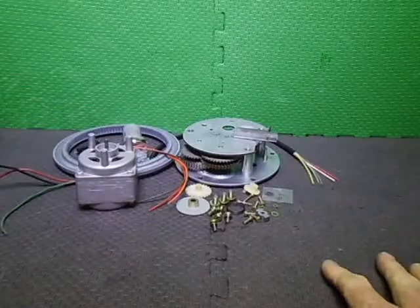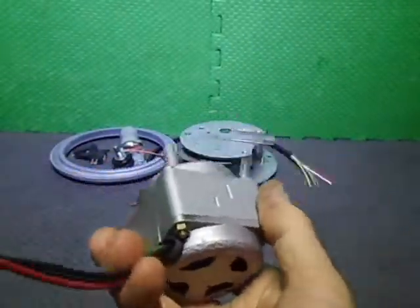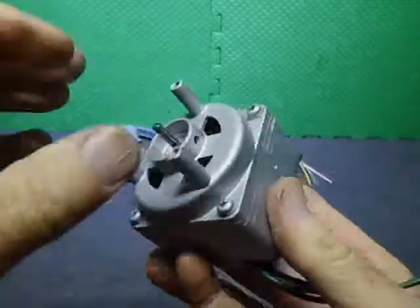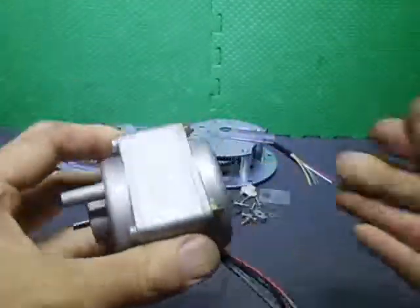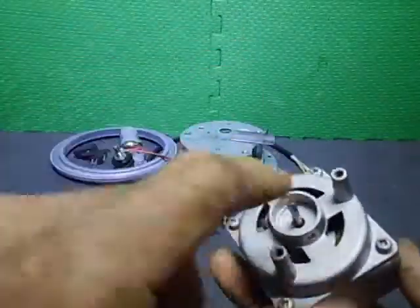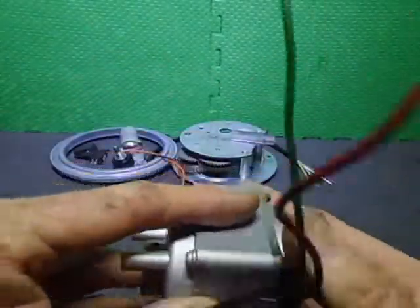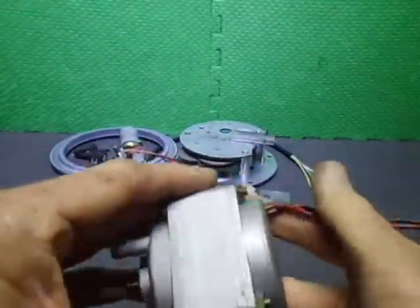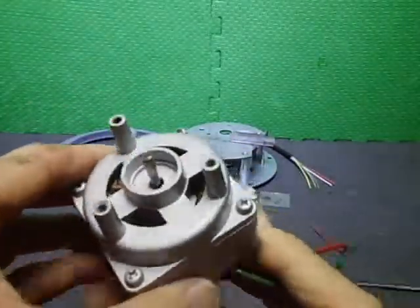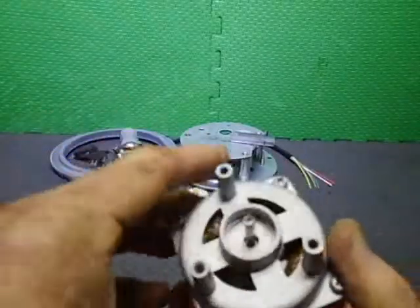The motor itself - the KR600, DR7600, same thing. This motor was completely stripped down. The top and bottom housings had a little bit of electrolysis - that was a bit rough. That was blasted and re-coated in a clear. I cleaned up the actual motor laminations and painted them silver, so it looks pretty close and looks alright. I've got a polish up inside for the brake bit still to do.